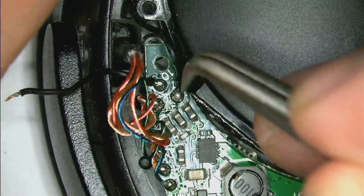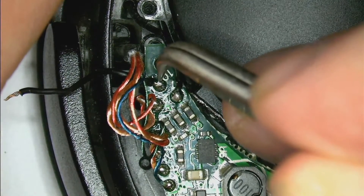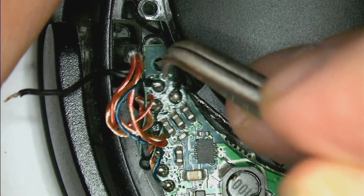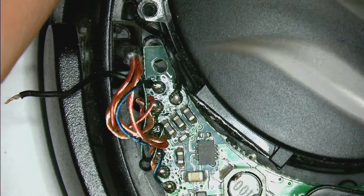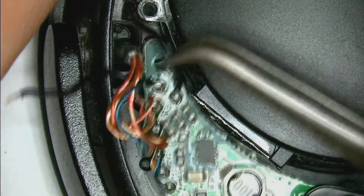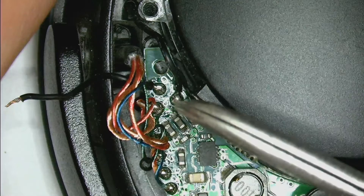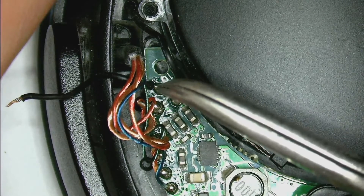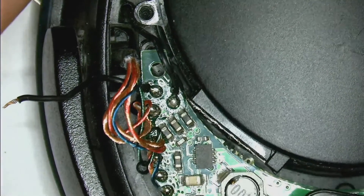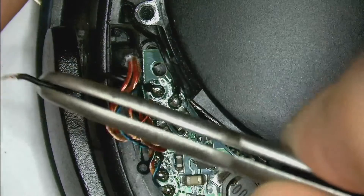Here is the negative terminal and this one is the positive terminal. I was able to determine this by inserting a metallic item into the battery well, and I noticed that the negative side would terminate into this point, and the positive would terminate into the battery latch cover. Since that one is broken, we know that is what we need to replace.